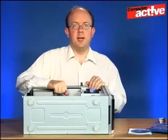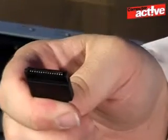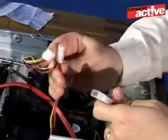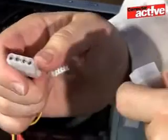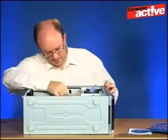Finally we need to deliver some power. It might be that your power supply already has a power connector on the end of the cables. Ours is a slightly older model so it doesn't, and so you can use an adapter like this. Simply find a spare molex connector and plug it in — again this is keyed so you can't get it in the wrong way. Let's push them together and then plug the socket into the back of the drive.